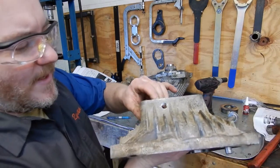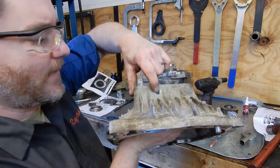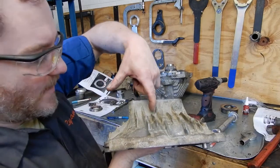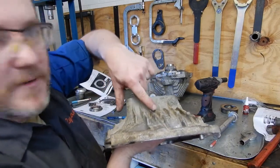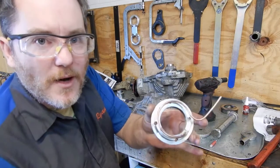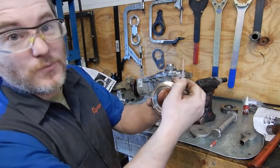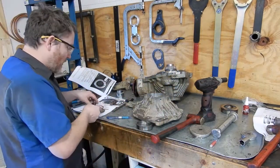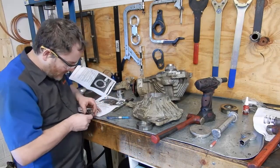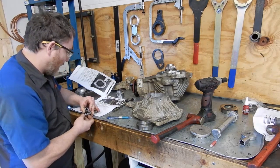So before the parts were cleaned and I forgot to film it, we went ahead and drilled and tapped our bulkhead fitting hole in the shallow side of the clamshell, followed the ARB instructions, came down 15 millimeters, and then centered up as well as we could on this casting rib. So we're ready to go back together there. And then we took a large socket and formed the coil and wrapped it. There's really good pictures in the ARB instructions of this. We've marked it at 20 millimeters from the end. So now we can go ahead, take our tubing cutter and trim that to length.